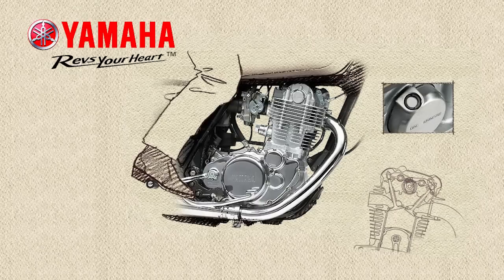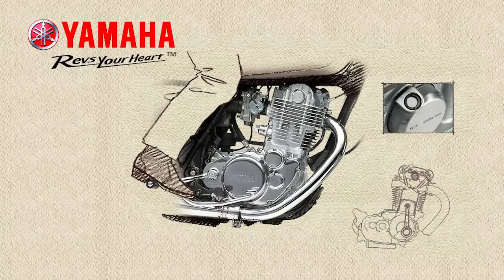This will place the piston just past top dead center, which is the best position for starting the engine. Release the decompression lever, then let the kickstarter return fully and give it a good strong full kick.